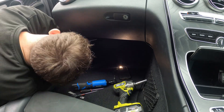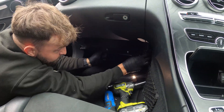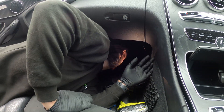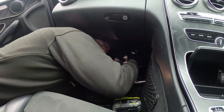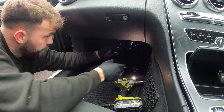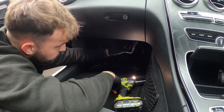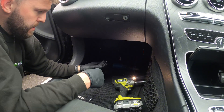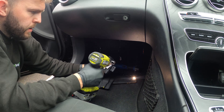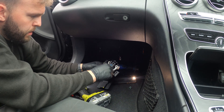Now it's time to replace the pyro fuse. If your vehicle hasn't been involved in an accident, you don't need to worry about this. This is a safety feature on many cars today — it will stop power running from the 12 volt battery to the car. This also needs to be replaced in order to get the car started again after an impact has been detected. On this model it's located underneath the glove box inside a little box, but on most other vehicles it's located next to the 12 volt battery.